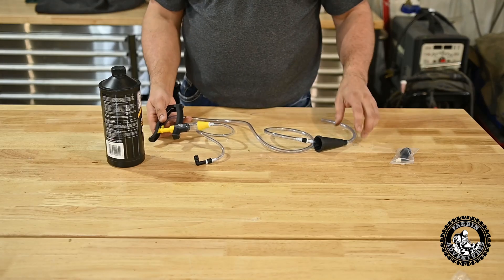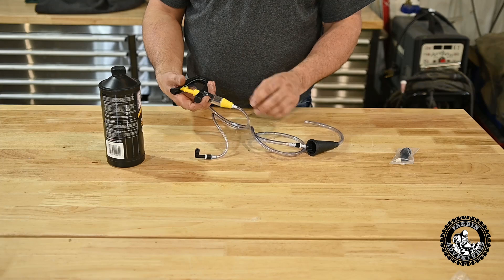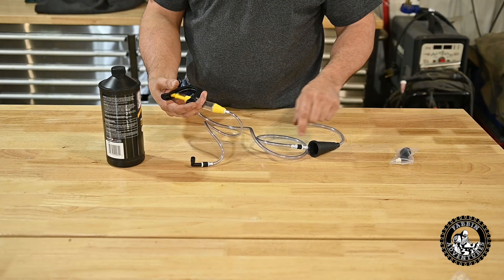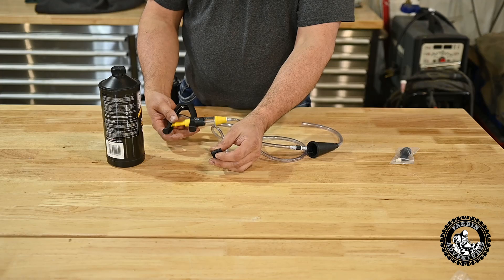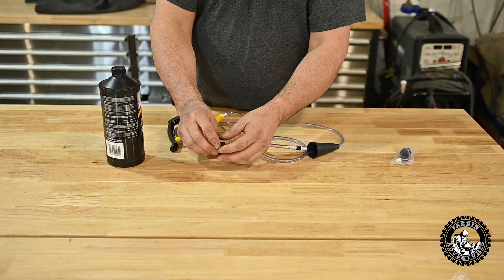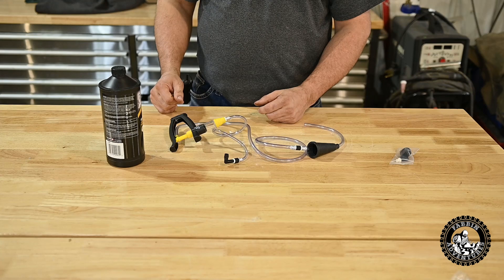What they say is to suck the fluid out of your master cylinder and pump it into a waste container. Make sure you get all the air out of the system — pump some new fluid through the line, through the system. Make sure you don't see any air bubbles. Then you're ready to go. Hook it onto your wheel cylinder, undo your brake bleeder there just a little bit, and pump. They say three to ten pumps should be enough to do it.